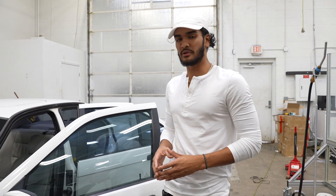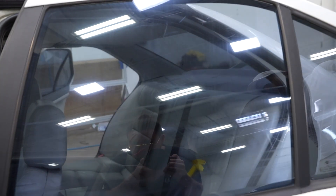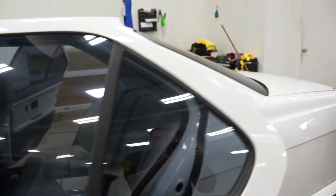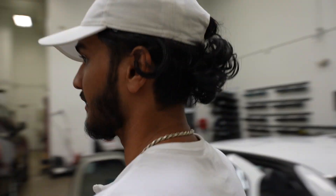It's been faded. We'll install some Xpel XR Ceramic 20% film. As you can see, the windows are faded and blue. The windows look like they've been tinted about 10 to 15 years ago — they're getting faded and peeling. So the first thing we're going to do is get the steamer and remove this window tint.